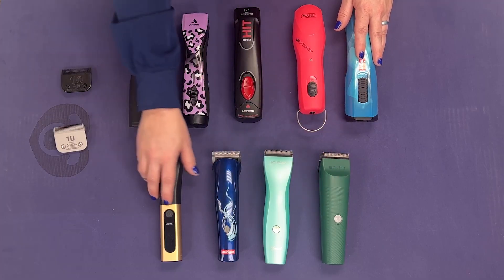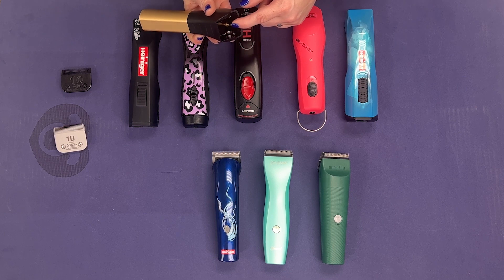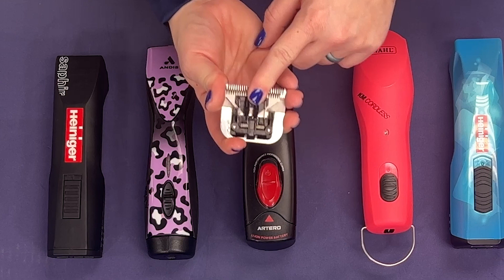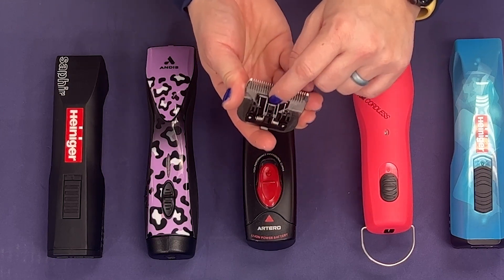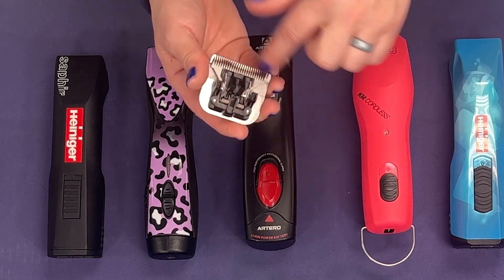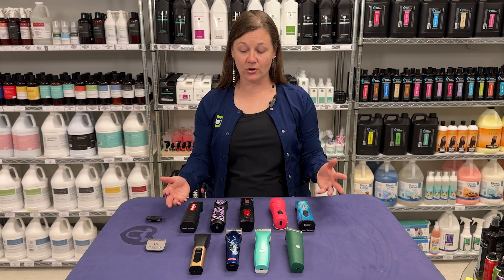All of these don't even have a blade drive or a lever to change out. They literally have a metal peg that spins and causes your cutter to move back and forth. Now, if you don't keep this cutter notch greased, it will actually wallow out and it will have a big circular pattern from that metal pin, and then your blade will no longer cut for you.